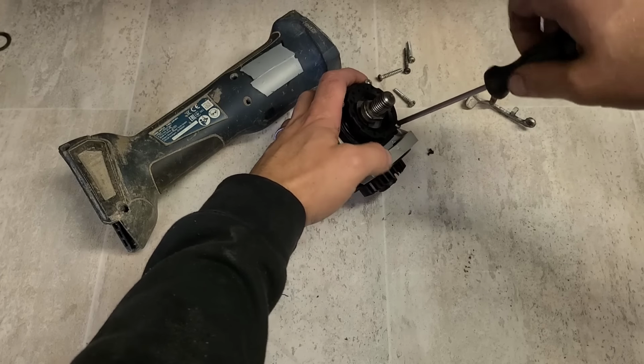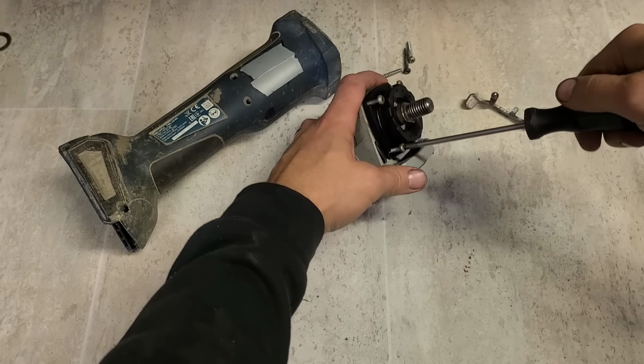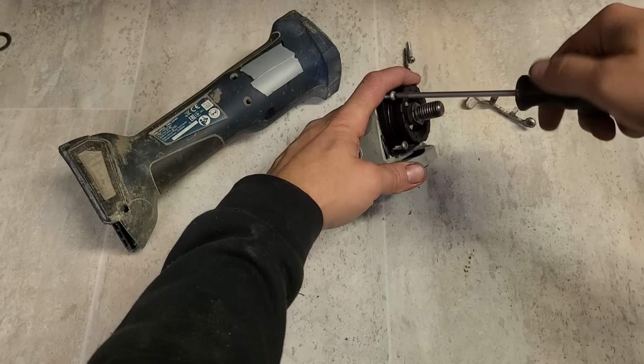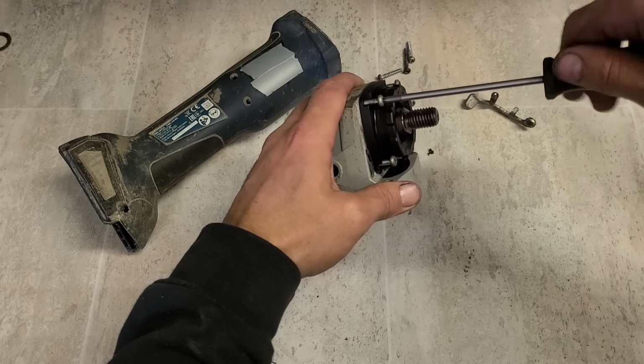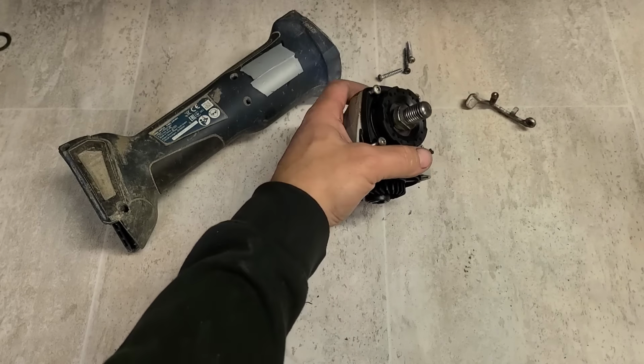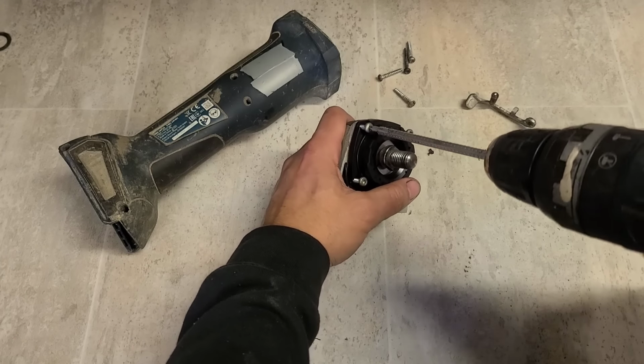These are wild for cross threading, so do start them before you drill them on fully. Left hand first, till you hear the click. They're self-tapping screws, and if you just go ahead and drive them in, they're going to cut a new thread.